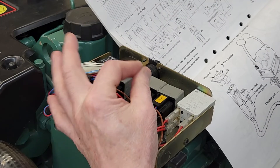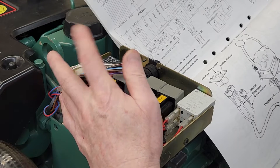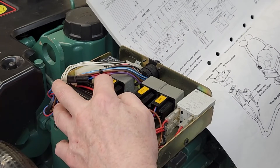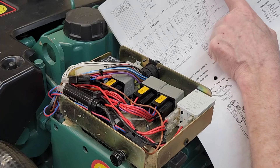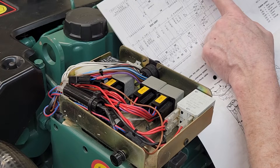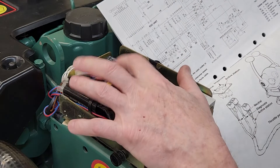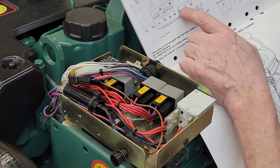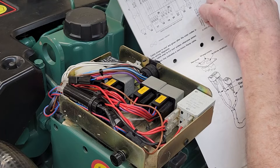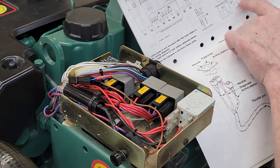The main relay is normally a closed relay, and when you energize that, that relay has no power going through it. The ground relay is another relay in the picture here. When that relay is energized it supplies the path to ground — so it's not blocking ground. When this relay is energized it supplies ground not only back to the battery but also to the block. That way the injection pump stop solenoid has a path to ground because it's grounded through the block, supplying a path to ground through the block back to the battery ground.